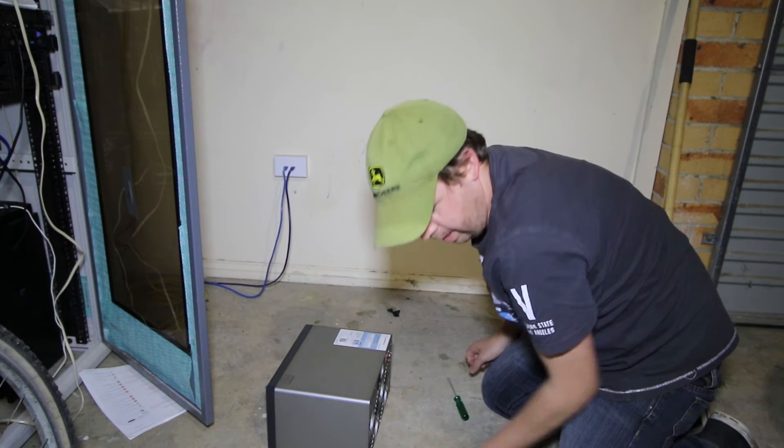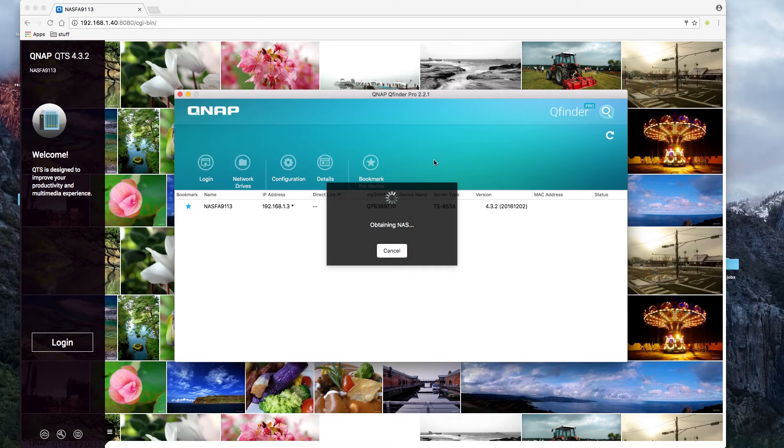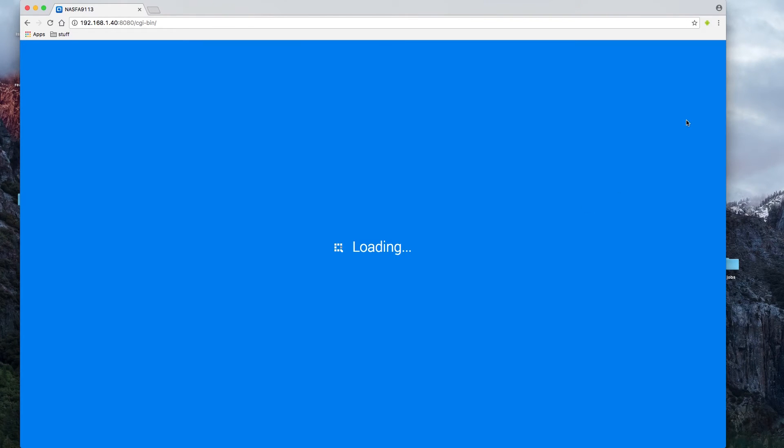And that's it. Now it's time to start it up and see what happens. Alright, we're back. I have now loaded up the NAS, it started up, and what we do now is go see if we can find it. Fortunately, QFinder actually does locate the NAS, which is really good. I've got it on DHCP and also a static DHCP as well, so I can easily find it — I've got two IP addresses just to make sure.